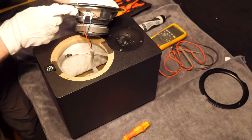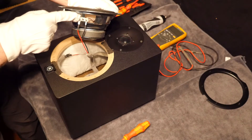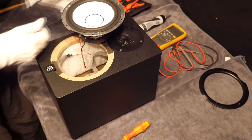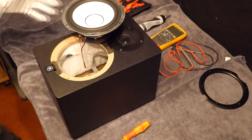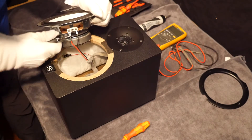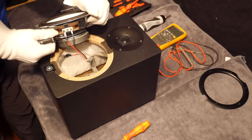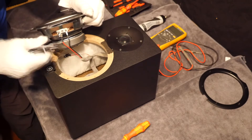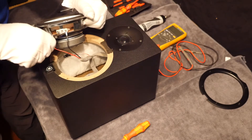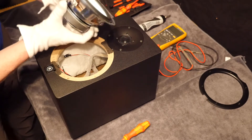Now make sure you don't break that white plastic rectangle because that is quite fragile — I will show you it now. So here it is: that is the little rectangle which is very fragile. We have got our red and black wire there which we now need to use a pair of pliers to carefully prise off. Now as you can see they are very tight so you really do want to be careful not to break that piece of plastic. The positive is a bit wider, and the negative is narrower and easier to come off.